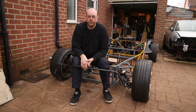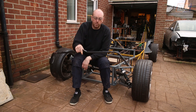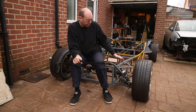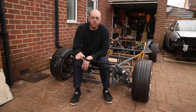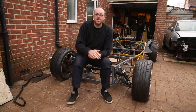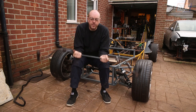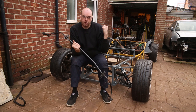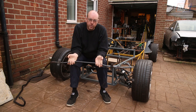Now we've got the front of the car back together we can look at the last missing component of the suspension — the front anti-roll bar. We tried to fit this a while back and couldn't make it work, and we didn't know where the shocks were going to go. Now that we do, we know the front anti-roll bar doesn't fit anywhere. However the rear anti-roll bar fits quite nicely — we can fit this back in and borrow it off the rear temporarily to make it work and just get another one. We can thread this through and connect it up.